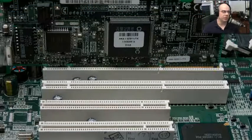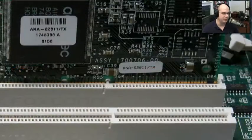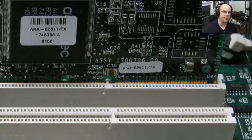When you have a card in your computer, you should be able to see that it's fully in the slot. There should not be cases where the card is sticking out just a little bit and you can see those copper connections coming out of the end of it. If we zoom in, you can even see some daylight coming through that connection — that should not be the case. These should be fully seated inside of those slots. Even sticking up just a little bit can create problems, so make sure these are screwed in properly.